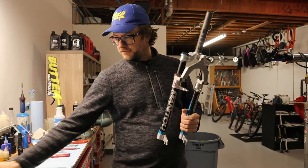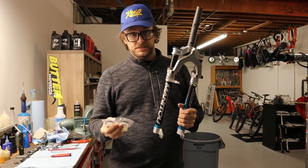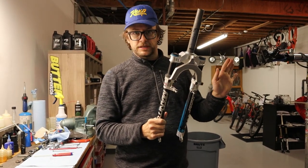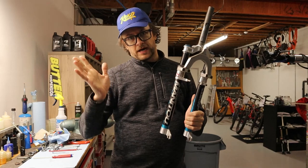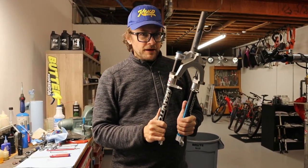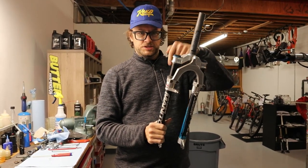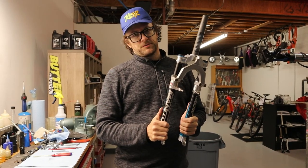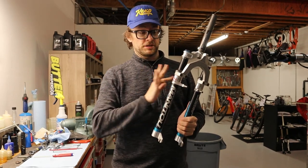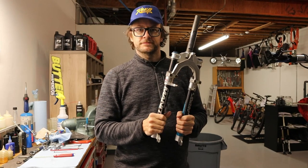And because I hoard parts, I have a brand new seal kit for this thing, as well as bushings. So basically it's a complete rebuild, all new parts. But this thing is so clean inside. It's more of a showing you how it goes when everything is in good shape. If you are thinking about rebuilding one of these, the first thing I would do is check the condition of the elastomers and how much time you really want to spend on it. Because when they melt, when they totally gunk everything up, it's a nightmare. So come along, let's party.